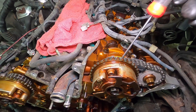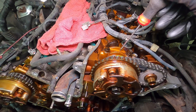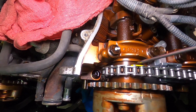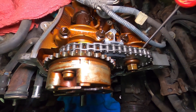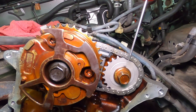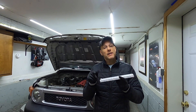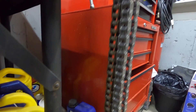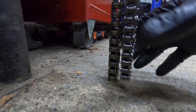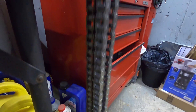Regarding these vertical lines — this will come into play when you install the main timing chain — the notch on the bearing cap is in between these two lines. Also, you have the yellow link, and the notch is smack in the middle of the yellow link. Off to the exhaust side, that little dot is smack in the middle and lines up with the notch on the bearing cap. Now let's see how bad the timing chain has stretched — you can clearly see we do have a stretch. This little variation, that's all it takes — super small, but we have to repair it.